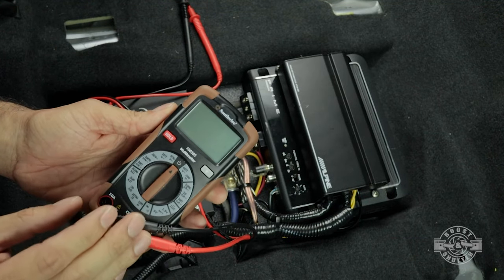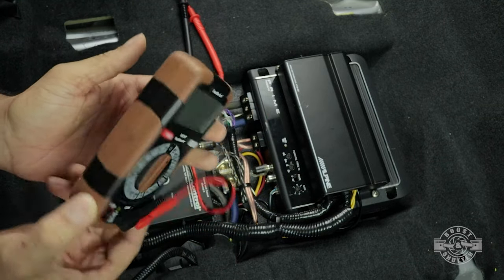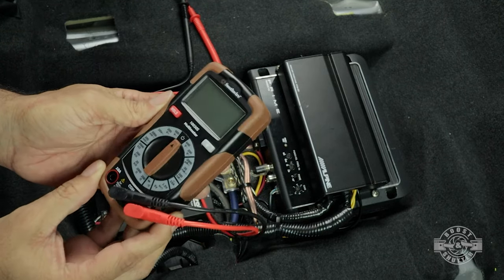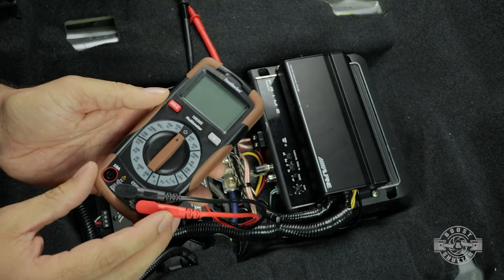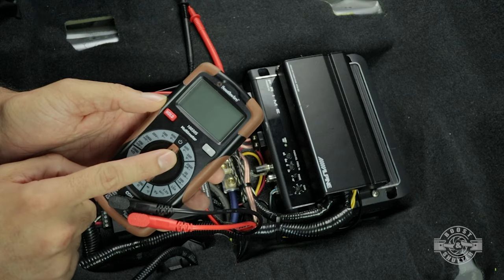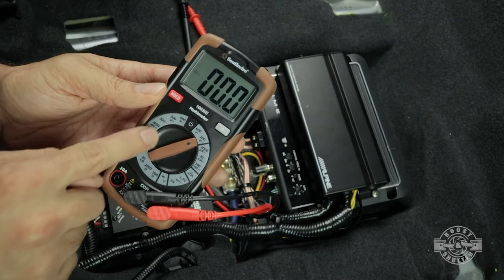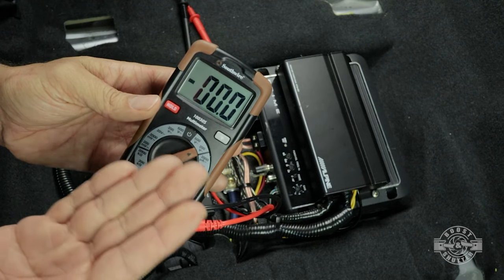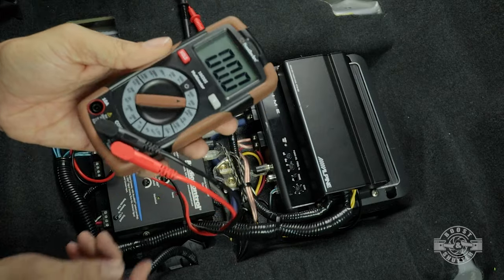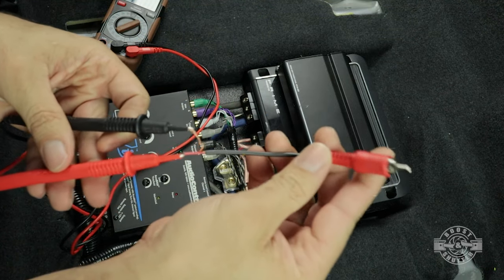To set the gains as I'm going to show you, you're going to need a multimeter. I think I bought this at either Lowe's or Home Depot — they are very cheap, there's really no excuse not to have one. The only thing you have to ensure is that the multimeter reads voltage AC. If you get one like this it might seem complicated, but it's really not — the numbers just denote the range on the screen and where the decimal point is going to be.